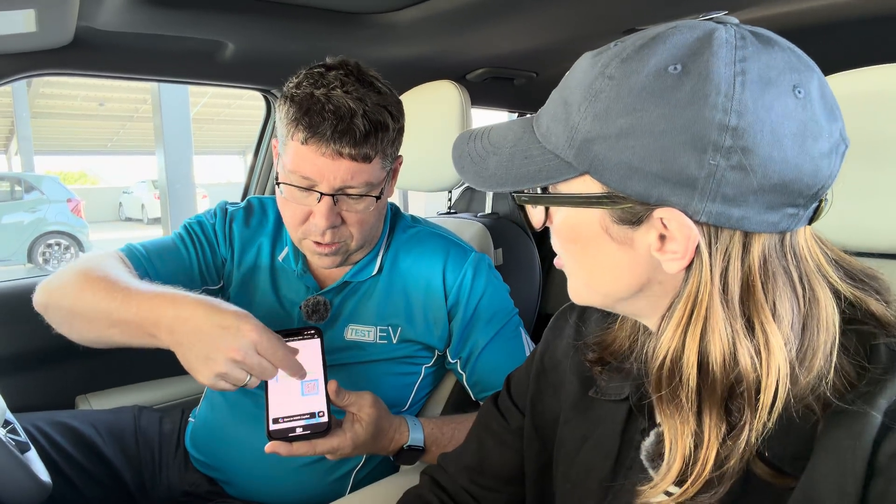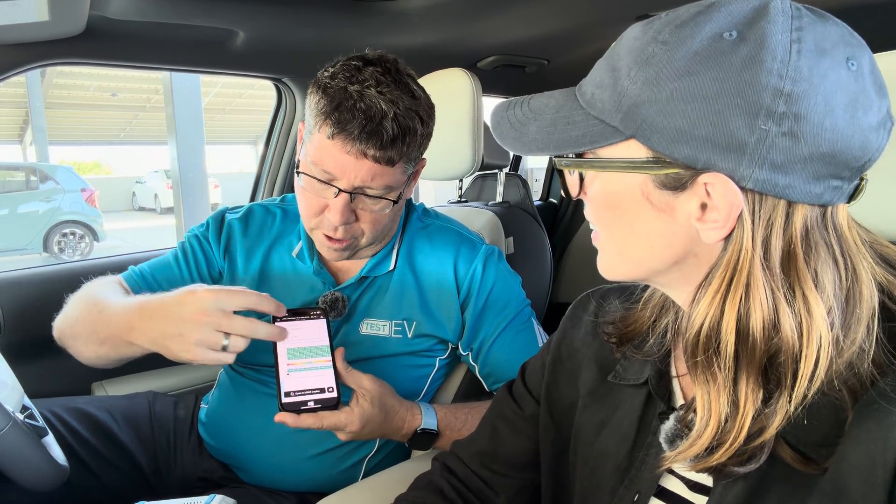We've got the result via email — 99.8% battery health on this Kia EV3 GT Line, which has 3,933 kilometres on the clock. It also gives a benchmark showing how the vehicle compares to all similar cars tested, and it's right in the average zone with excellent health — which you'd expect on a 4,000 km car. The second page gives us technical detail including usable energy, expected real-world range, and a heat map showing how balanced each individual cell's voltage is.